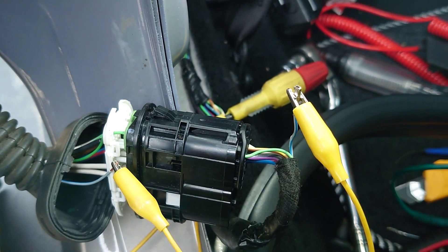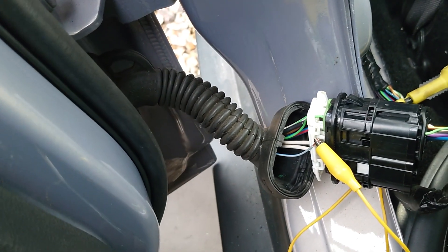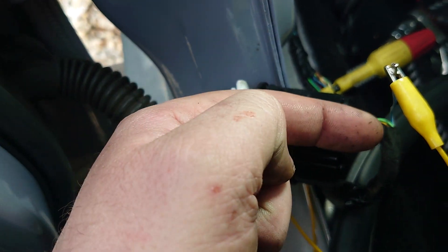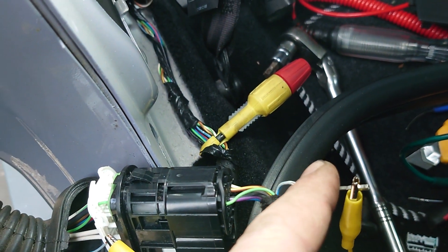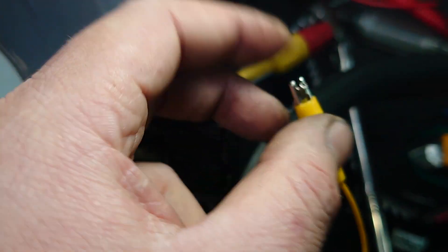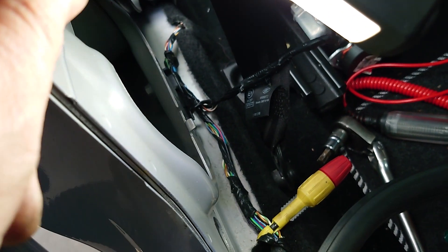Other options: if you wanted to repair it, best option would be to tick the door panel off, cut the wire there, feed it all the way through and through the plug, then join it over on this side with solder so it's not on a flexible joint. My advice to the customer is going to be to put a new pin on and get a new door loom, but you can do it whichever way you like. Happy days on that one.